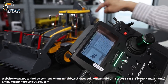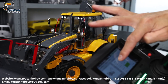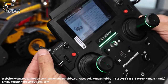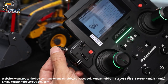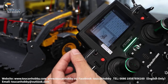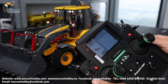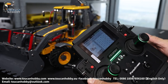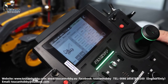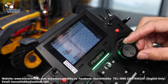Forward has light, rear side has light. And channel 12, SWE. SWE channel 12 — that's for switching on the sound: horn and engine sound, start and off. So that's SWE. Channel 13 is again controlled by J1. That's the turning signal light — same with steering, turning signal light.